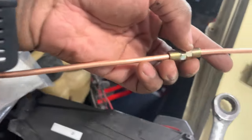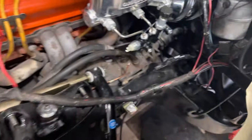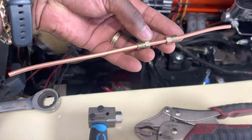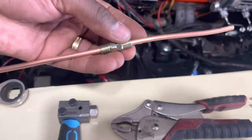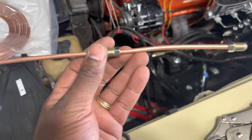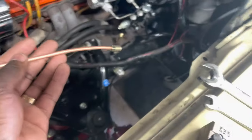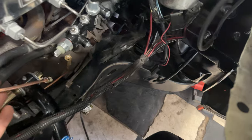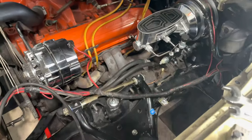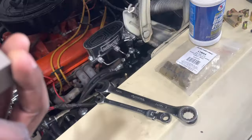It's better to have the line straight to actually do this. What I'm going to do is keep this straight and then after I have everything set up, I'll bend it to the right position and shoot another video after I'm done. It's pretty much just one straight copper line with two fittings. I'm going to create the ends to keep these two bolts stable. The tool I used for this I bought from eBay — it's a Capri — and it works real good to flare the lines.